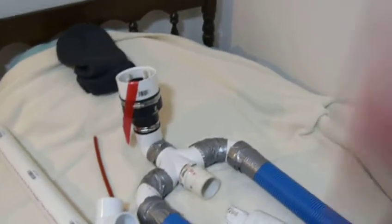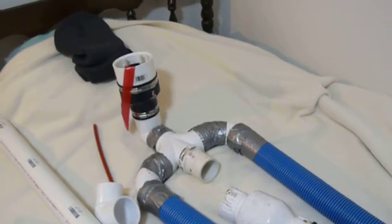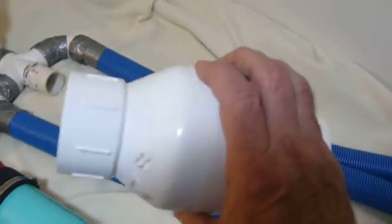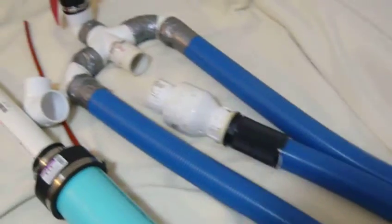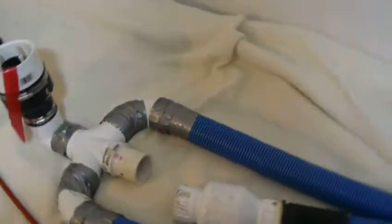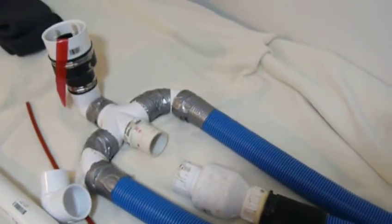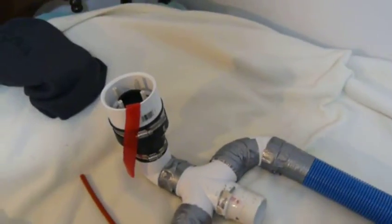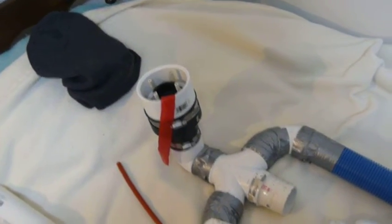You have to keep it vertical. I don't think it will work laying on its side or upside down. This here is a half-pound spring in this device — this is a check valve. This will help restrict the air going to the third vacuum motor. You don't want the air to go to the third vacuum motor because it will spin it too fast, draw amps, heat up, and pop a breaker. That's my experience using booster vacuum motors on a parallel setup, and it ultimately brought me to this idea here.